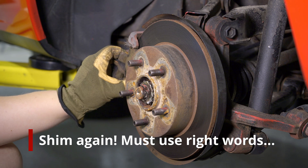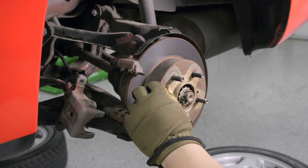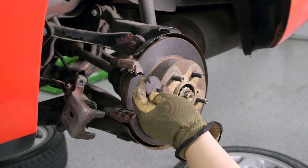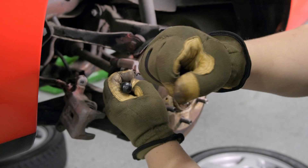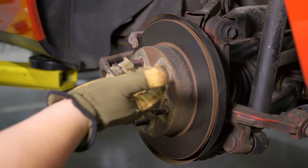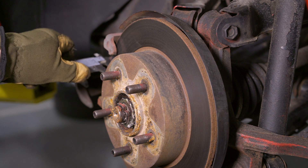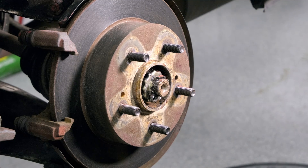Here's a little front plate and a little brake pad — again looks Nissan OEM, looks like it's still got a ton of meat on it. But I don't like the dusting and the squeaking. There's another clip that sits in the back around the pad. We bust out the little screwdriver and give things a couple of little whacks. Two more clips sit at the top and bottom of the pad. Before getting started, it's a good idea to measure the rotor thickness. In our case the rotor thickness is 9.23mm and 8mm is the minimal thickness — we're fine.